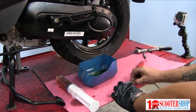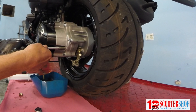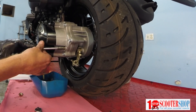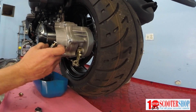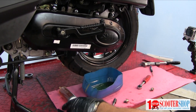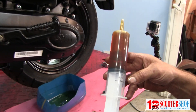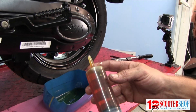This is the outlet of the gearbox. We have to also open the inlet. There's no real way to measure the oil once it's in the gearbox, so we have to measure it ahead of time. We drain the box completely, allow it to drain, cap it, and then put in a pre-measured amount — 110 cc's of gear oil — using a syringe type applicator to install.